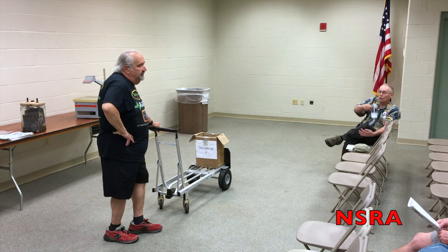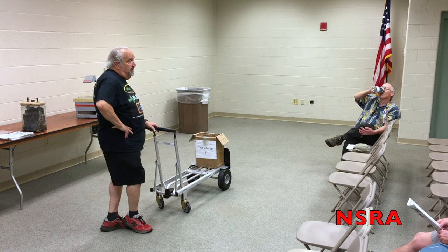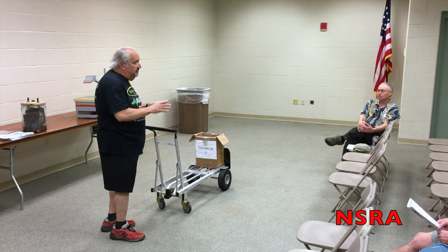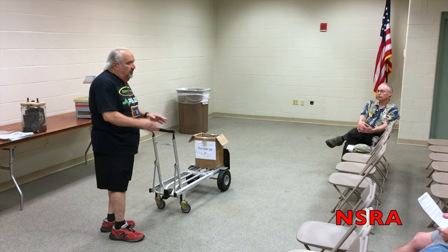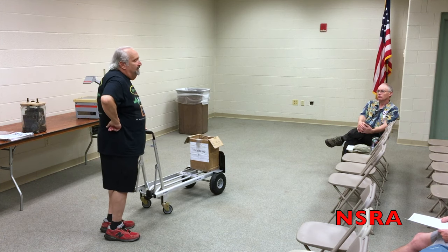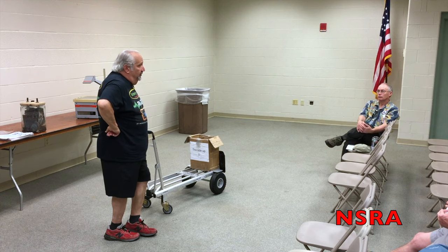My 6-volt cars are 6-volt cars. I left them at 6 volts. I have an Optima in one of them because it's a hard starting car. You can actually put two Optimas in the same space. So if you've got a big Packard or some old car that's 6 volts, you put two of those in, you could weld with them. You've got over 1,000 cold cranking amps. So that's another alternative to going to 8 volts.